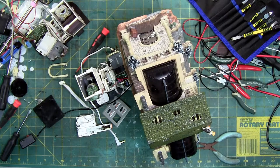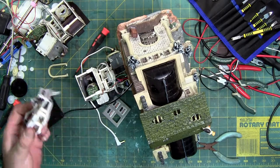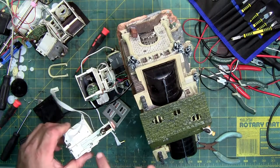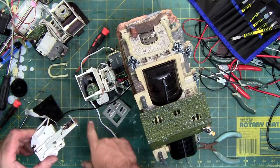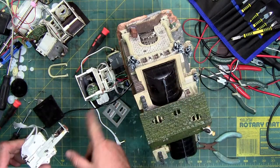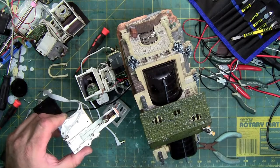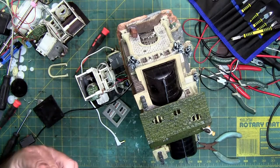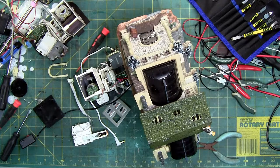Thanks for watching this — one of my shorter ones, but it goes over the components once you're inside this thing, so it's a little more detailed than the original video. The original video tells you how to take it apart and fix a lot of it, but this is more detailed since I get a lot of questions on this guy. Use the magnets — you've got to fix the magnets. One's on the sled, one's attached to the plastic housing, and that is your delay to allow Mr. A Gory Mess to drop before the door closes. Thanks for watching this shorter video. Until the next one.